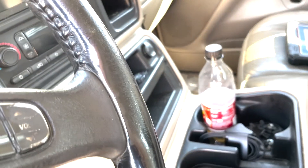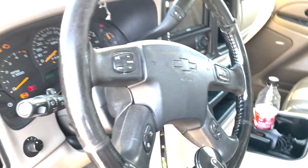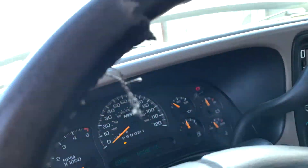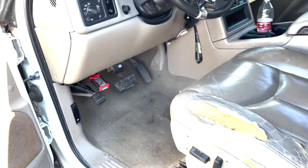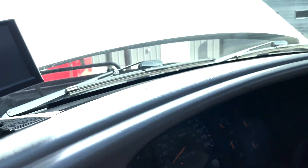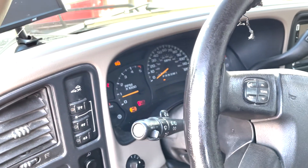With this truck having a priming issue and wanting a fast prime, it was kind of a good thing. That sending unit had a couple of holes rusted in it. So, key on — you can kind of hear that thing running, it's not real loud, pretty quiet. And it fires right up. No priming issue now.